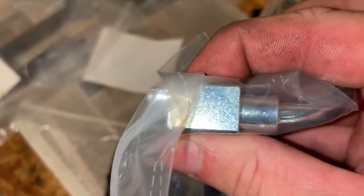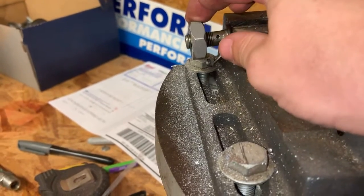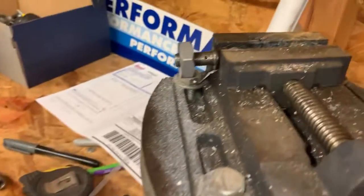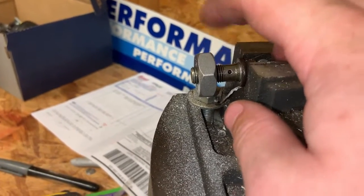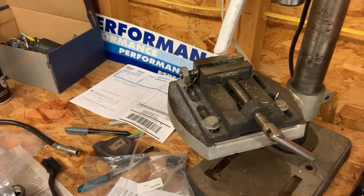What I'm going to do here is — as you can see, this brake line I had on it is a lot thicker than that. These banjo bolts were just a little bit too long, so what I'm having to do is cut just a little bit off the end. I put a die on it so that the blade goes straight, and also in case the threads get a little messed up I can just run that right back off and it'll clean the threads up. Then I don't have to worry about trying to get a tap on something with screwed-up threads. I'm just using a little hand saw because I don't need sparks everywhere. Then I'll clean it really well and put the other brake line on. Now that I've got a little bit of the end cut off, I'm going to use a flat file to clean up that edge.